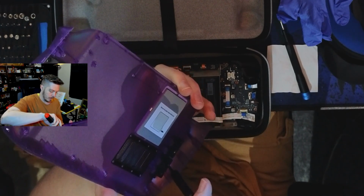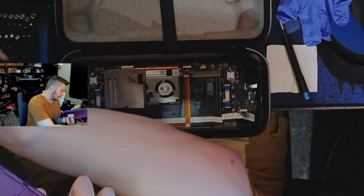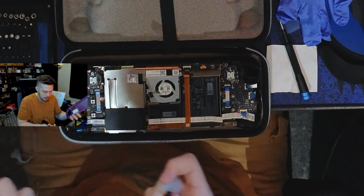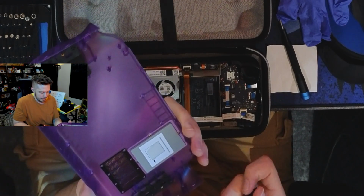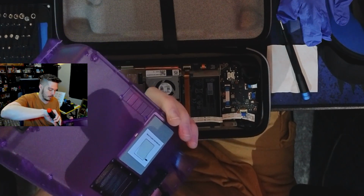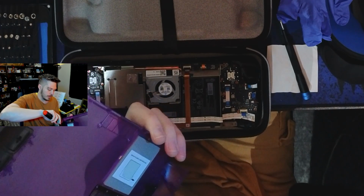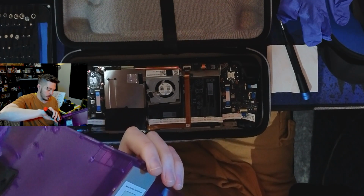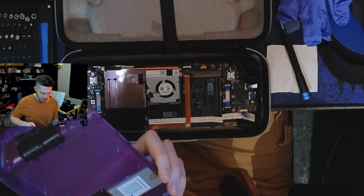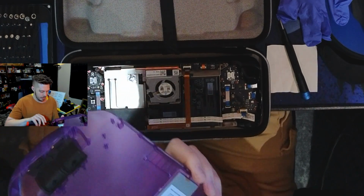There we go. So there's a trick for doing this more correctly, which is to screw back just a little before you screw forward. Got 2 of them that time. Generally speaking, that is a concern, especially if you're dealing with plastic. But like I said, these inserts here are brass, so they're very resilient. It would be very difficult to cross-thread these. Still possible, don't get me wrong, but very difficult. So I'm not going to bother. Although, when putting the screws back into the deck at the end, I will be doing that method, you'll see.